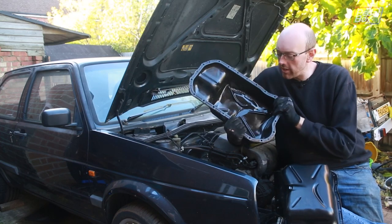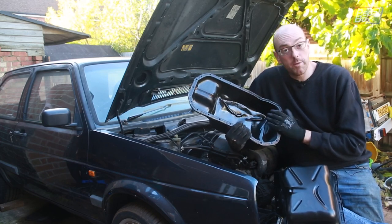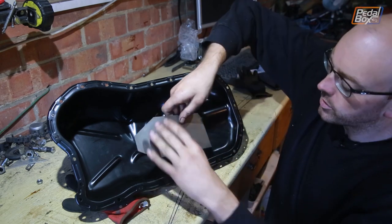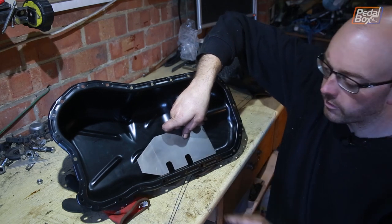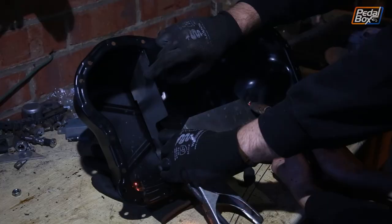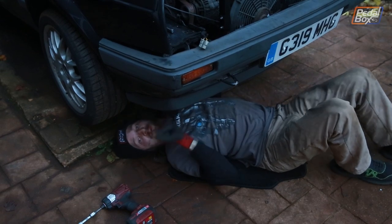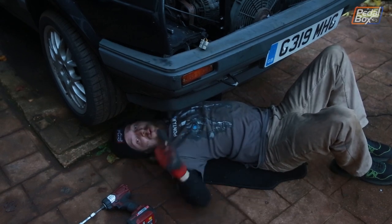The other interesting thing we found out was apparently this sump is not baffled, so when it did land I don't know what was vibrating against the crank or something else, but apparently there was no baffle or they've worn down so far they've completely disappeared. This is our new sump, and these are the baffles we got from Matt at United Motorsports — thanks very much to him. These go into the bottom of the sump; this one welds onto the little lump at this corner, and this one tacks on here, then this lateral plane one goes in just along here. We've just tacked everything in place, really loosely bolted it up with two screws, and spun the engine over to make sure nothing's misaligned and catching — so far everything seems happy.